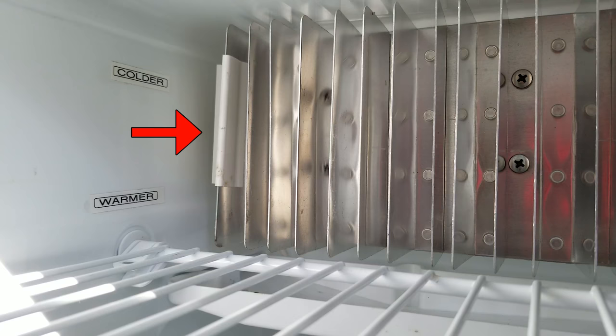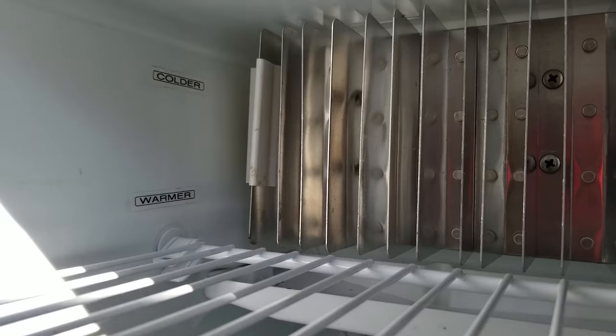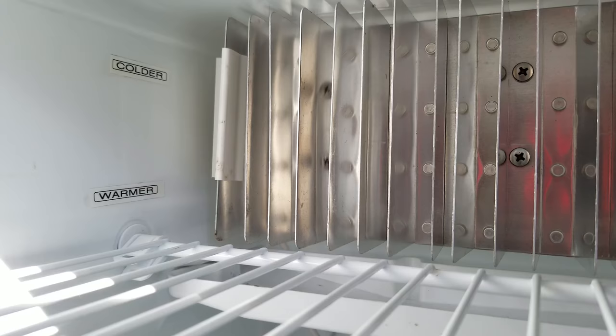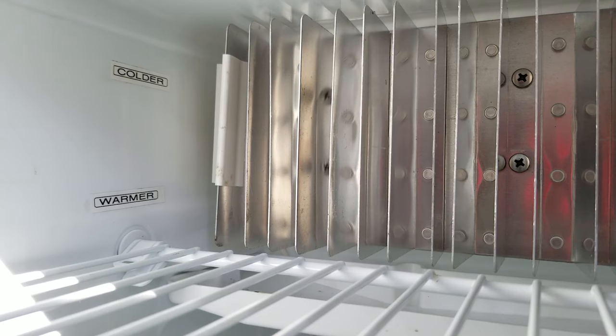Part two of our equation is this little slider right there. It's a resistor — it changes resistance based on temperature. So as the temperature changes, the resistance value is going to change, and that is an analog value that's going to go into our control board. Sometimes they're on the right-hand fin and sometimes on the left-hand fin. I've gone ahead and made a sticker and wrote 'colder' and 'warmer' because this customer did not have his sticker. That slides up and down on the fin. If you go up on the fin, your refrigerator is going to run a little bit colder. If you slide down on the fin, it's going to run a little bit warmer. Let me pull out of this refrigerator and explain how that thermistor works with the one through five buttons.